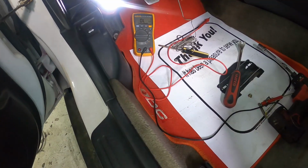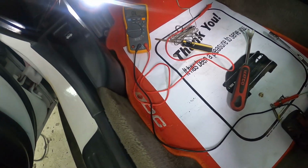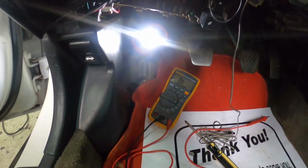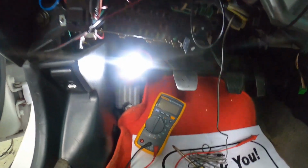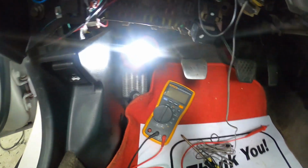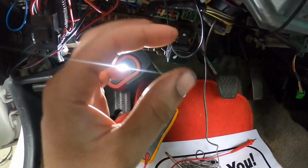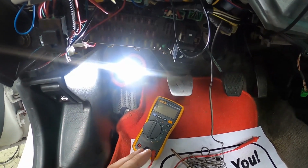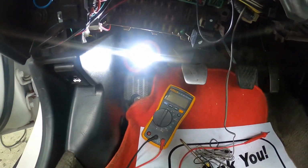All right, guys, so I've completed a little bit more testing, and I think I've got it figured out. It actually ended up being much simpler than I expected. I don't know what was going on with my voltmeter. I think it was kind of throwing me for a loop for some reason, because like I said, when I ohmed from the fuse to the connector on the strut, I got like 1,000,000 ohms. So I found the connector on the back of the fuse box that has the wire going out there to ohm from that connector to the connector on the strut, and only had like half an ohm. So I thought, oh man, it must be in the fuse box where all that resistance is coming from.